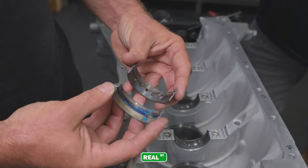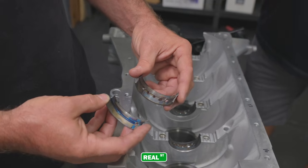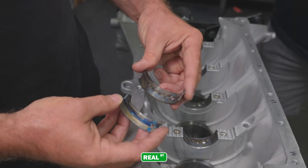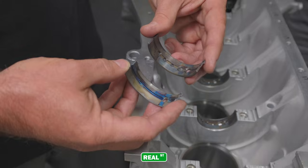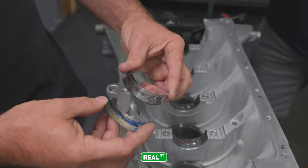The single hole bearing is a native bearing out of a rear wheel drive SR20DET. And the five hole bearing comes out of the GTIR, the Pulsar GTIR SR20 motor. Actually, the five hole is an earlier part. I guess when they went to the rear wheel drive version, they just decided to stick with the single hole bearing. I'm not sure what the reasoning was behind that, but